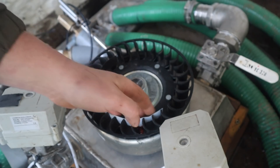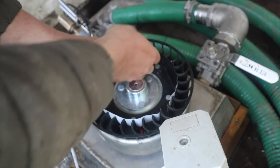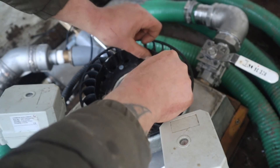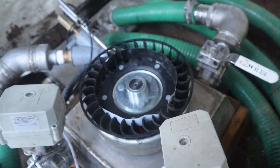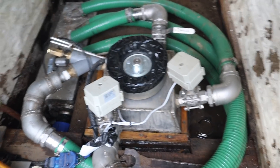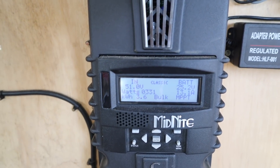I'm going to put tape around the fan to stop it being able to pull in air, so we can see how much the fan uses. It won't be a perfect test but it should give us a pretty good idea of the loss involved. If it was upwards of 50 watts I might think about changing something, but I think it's probably going to be a pretty acceptable loss. There we go - with the fan taped up, really not very much at all - just a few watts.